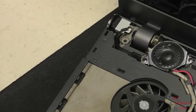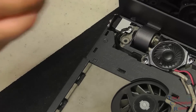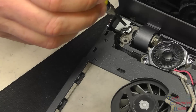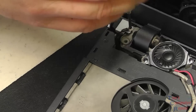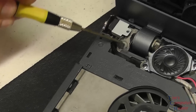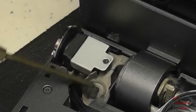Flip the laptop back over and you'll see the power jack is covered by a metal bracket. Take note of what this bracket looks like now, because we're going to have to modify it when the new power jack comes in. We'll take out the one grounding screw. Notice the area I've highlighted in red — the bracket folds down and around the entire power jack, and that area in red is going to have to be modified once our new power jack arrives.